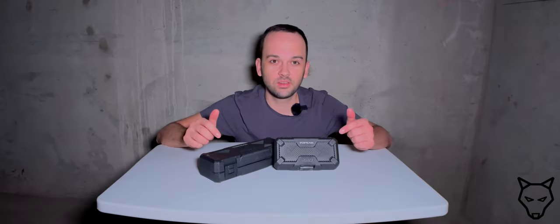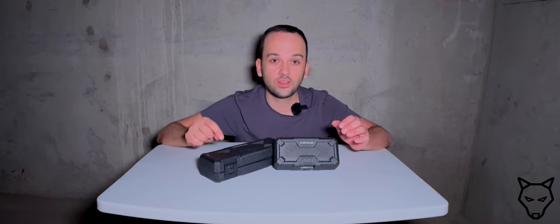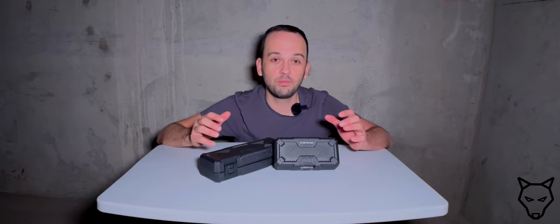Episode of the Shop Essential series, we are featuring these, the Topeak Torque Stick Pro in the 2-10 and the 4-20 newton meter range. These products are absolutely essential to any good shop or anybody who has any carbon fiber parts on their bike. If you have carbon fiber bars, these are going to be absolutely essential to actually getting the torque set correctly for your brake levers, for your grips, for your stem, so that you don't prematurely damage or fracture those fibers in it.